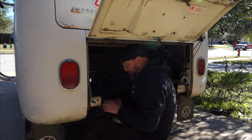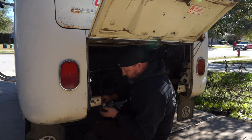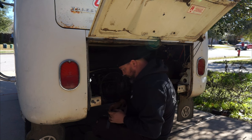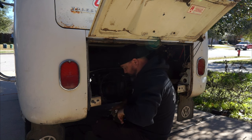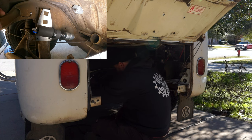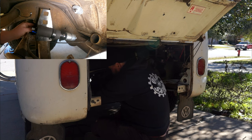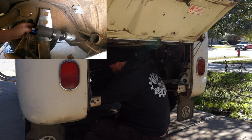Here I am behind the motor now. We're going to mount this bracket — it's pretty easy, actually very well designed to fit exactly where you want it to go. The hardest part is reaching these little nuts when you put it on. Take this little back piece off here and I'll show you how it sits. This little guy has a tab that hooks on top of the frame, which is exactly what you want because that's going to hold it. Then this little back piece will go right there and hold that fuel pump in the right spot at the right angle.